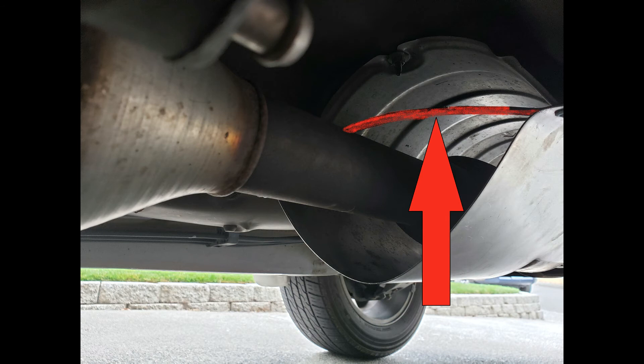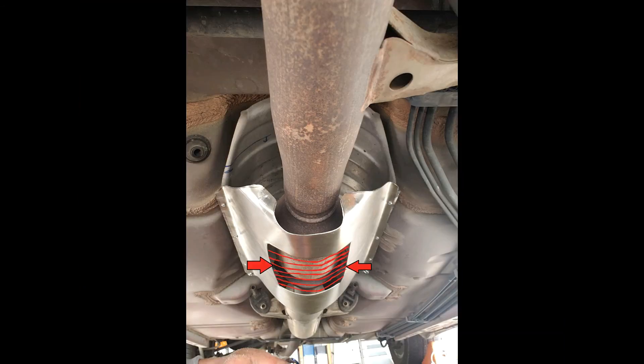That's the completed installation. However, since no prototype survives its first venture out, let me share some improvements I've come up with. The first improvement is to beef up the tabs in the front so they can't be bent out — I'll either weld on some extra steel or build that steel up with the welder. The same goes for the metal strap in the back; that needs to be much thicker. Finally, the hole I cut for cooling is way too large. Instead, I'll tack on another piece of metal that has a whole series of slots cut into it. This will provide airflow while driving, while making it much harder for the thief to use a sawzall to cut the guard off.